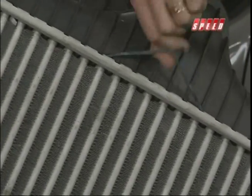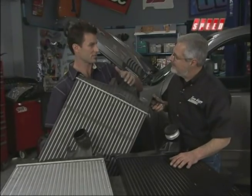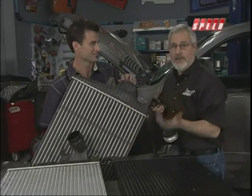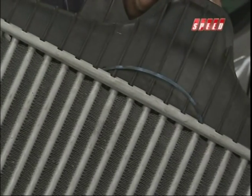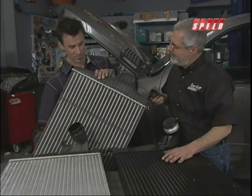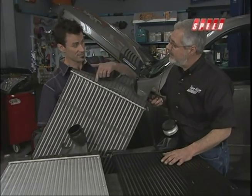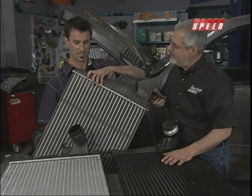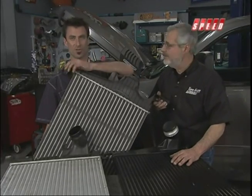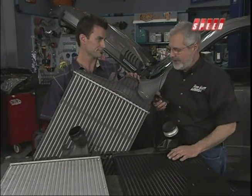When they put it together, there's an O-ring all the way around, and that O-ring can blow. A friend of ours — this is actually his Bonneville truck — he gets going through the run and that thing is gone. You just totally lose your boost. He put a bigger turbocharger on it with more volume and pressure, and it popped the O-ring — just like losing the turbocharger hose. The pressure coming out of the turbo goes through the intercooler to cool it, then goes into the engine, so there's just as much pressure in there as anything else. The OEM designs it for their pressure — when you upgrade everything from head to toe, you have to. That's why this kit is nice: it goes all the way from the intake through the exhaust pipe, and all engineered to work together for the best gain and good longevity.